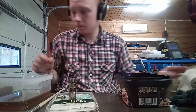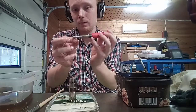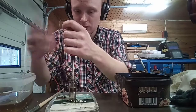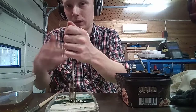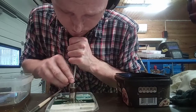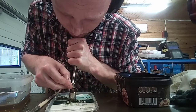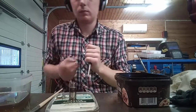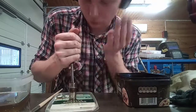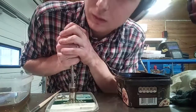The way I like to put these together is using just a punch — the same punch I showed in the beginning. Put the lifter over the punch, put the punch in here, and I'm right-handed so I press with the left hand. Press down — this can be a bit finicky but once you get the hang of it, it's not hard. Then just with your fingers, put it back together and put the clip in.